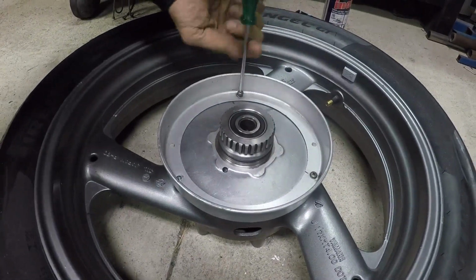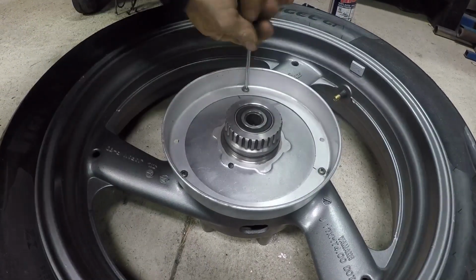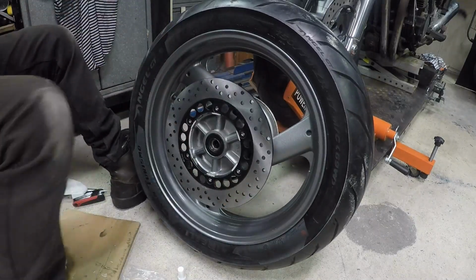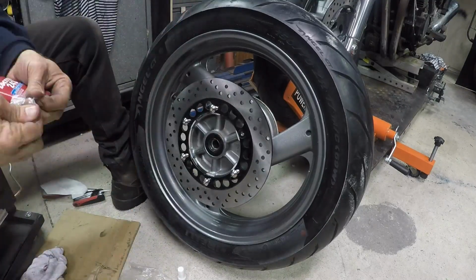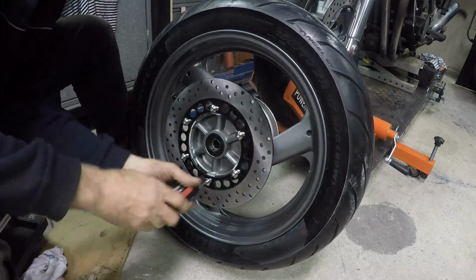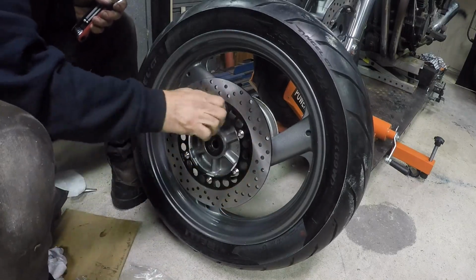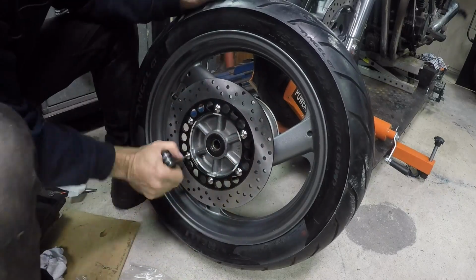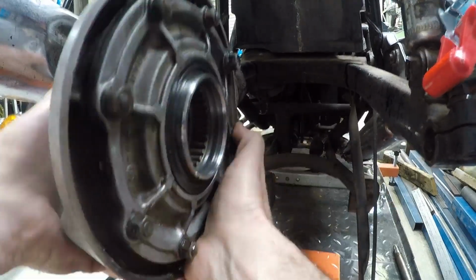It looks completely standard, and what I've done on that rim has allowed me to move over about 3, probably a touch more than 3 mil, and the machining I did on the diff has given me about 5 or 6 mil. So all up, I think I'm moving this over somewhere between 8 and 9 millimeters. I'm thinking it is enough. Here's a new disc I bought as well, so just putting that on.